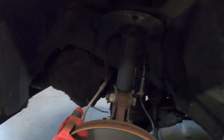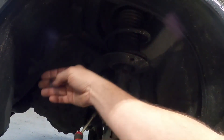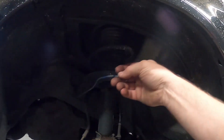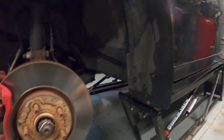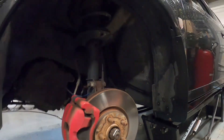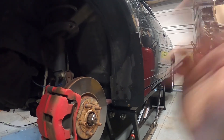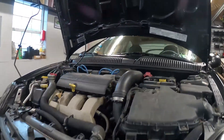I had all this stuff apart when I did the center mount about a year ago. It looks like we can delete this broken ground wire - nothing big. We decided to do this on a rainy day so the car is wet. We're going to drain our fluid, and then we need to pop this out to get our transmission mount. Get the axle stuff taken apart first, work on getting the transmission drained, then get started on the top.